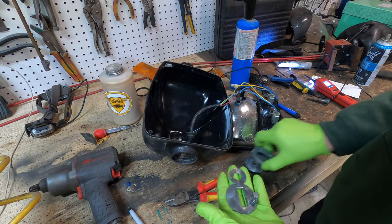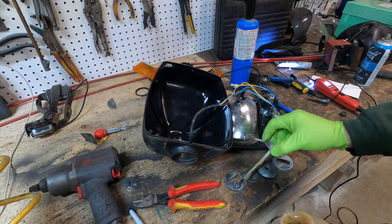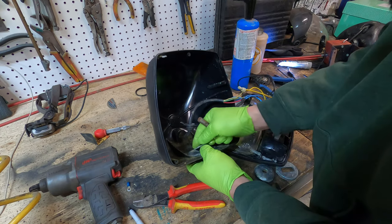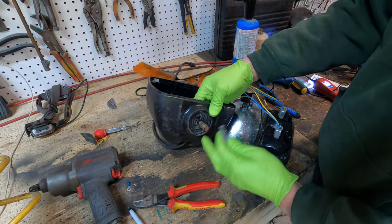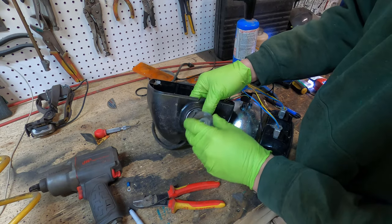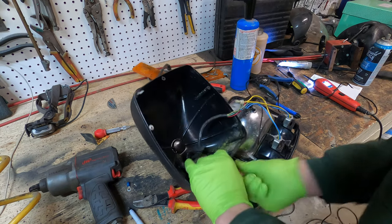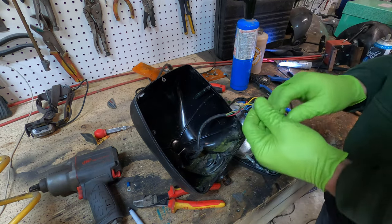Now I've got all the pieces cleaned, so they should be good to go. I'm just going to put a little bit of oil on them — just a rust preventative. It sits down in there like that, then our bolt with the washer, and then this piece with the little notch on it mates up with that notch there. And our ball-shaped washer. We'll put that in, the lock washer on and the nut. And then all we have to do here is attach our ground wire — I just rewired all this so it's a little bit cleaner and gets a good ground.